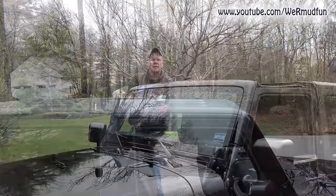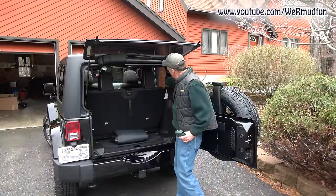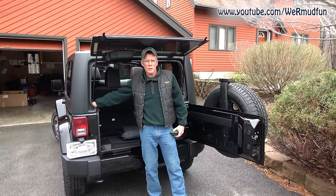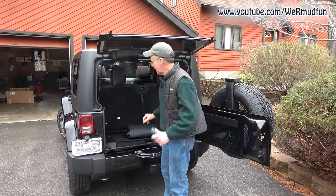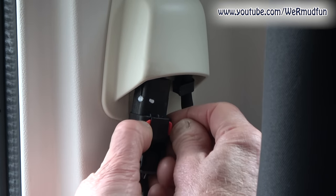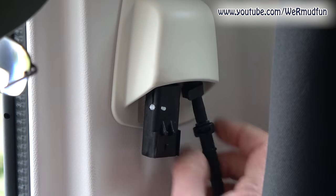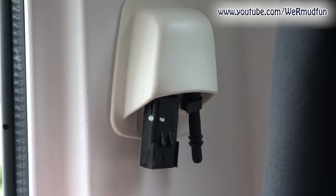Take the passenger side off next. There'll be three bolts on each side you need to unscrew. If you've got the trusty little kit that came with it, you're all set. You also have to disconnect the window washer fluid and disconnect the rear window defrost and wiper electronics. To disconnect the electrical, there's a red tab — slide it to the driver's side, push in and pull down. For the window washer fluid, it's oblong — where it's widest, push in there and pull down to disconnect.